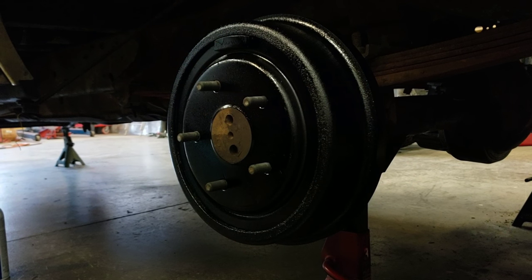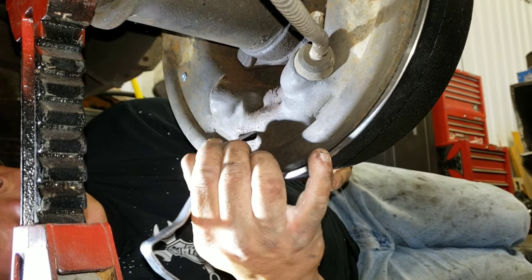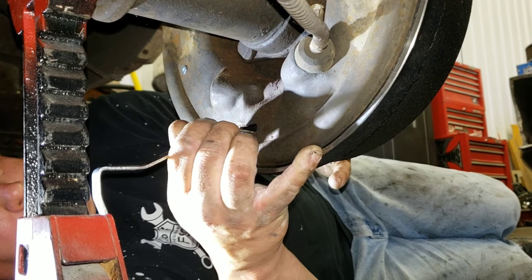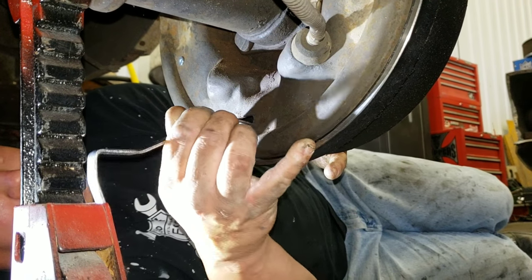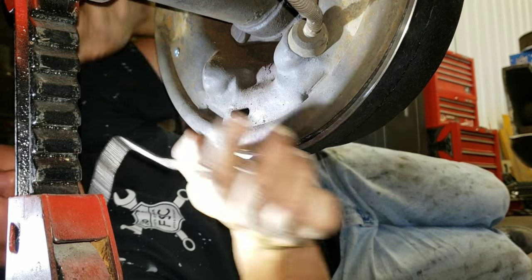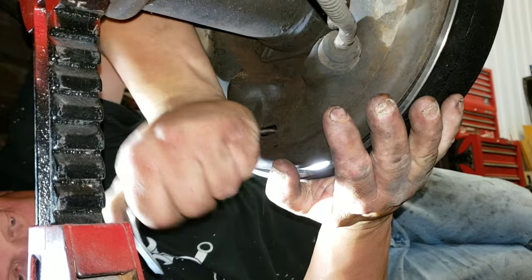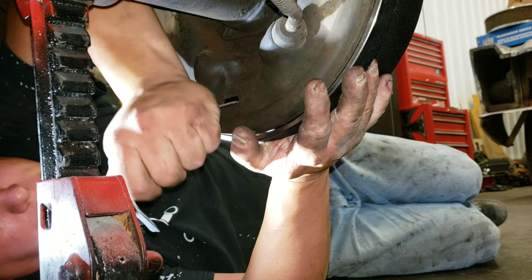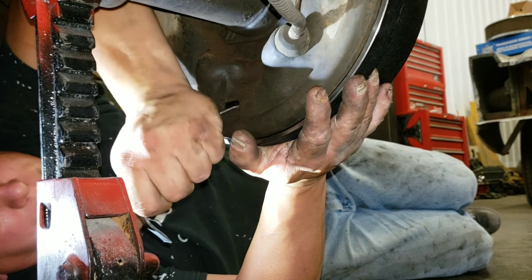Brakes need adjusted. We'll do that right now. Here at the ratcheting, that's that chrome piece with the spring and the cable clicking against it. Still very loose, obviously. Now, it's really hard to turn right now because the differential is brand new, and the differential is a little stiff, especially since she's a posi unit. She definitely turns stiff. But again, brand new.